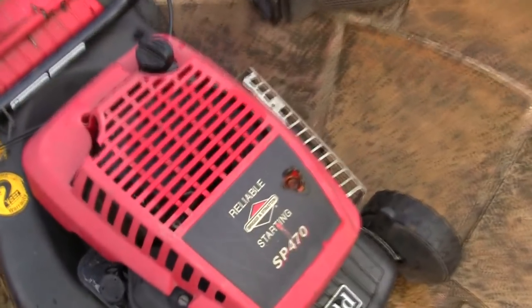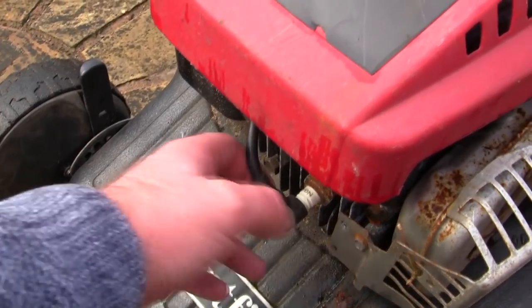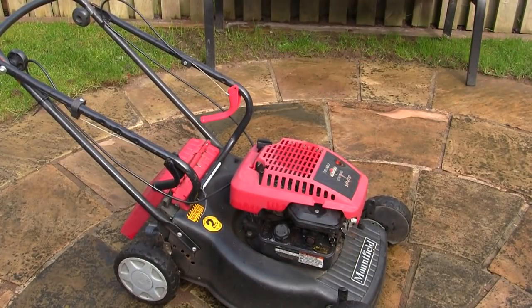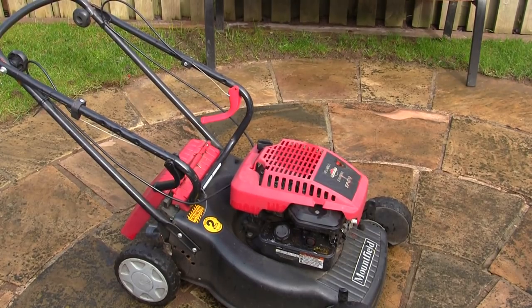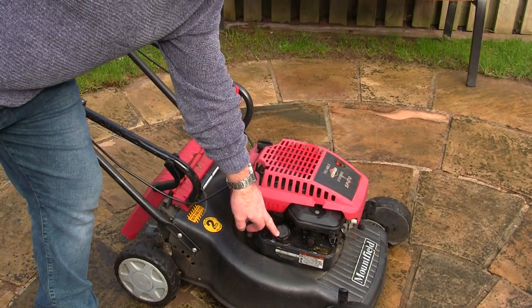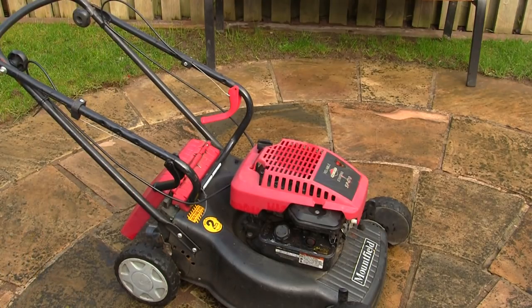The very first thing you're going to want to do with any lawnmower is take off the spark plug lead. What I would usually do at this point is try and start the lawnmower up and if it runs, extract the oil and fuel so I can tip it over. Obviously with no pull cord on here I can't actually start this mower, but there's something else to check - I'm going to tip this lawnmower on its side to check the blade isn't bent underneath, and look at the underside of the deck. Then I'm going to extract all the fluids - the oil and petrol - out of it.